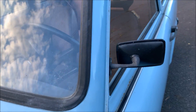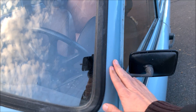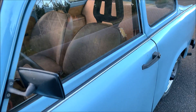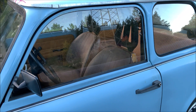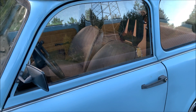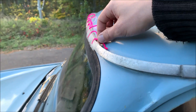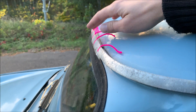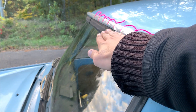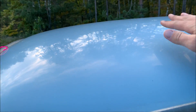The outlet will work over on the outside, where there's quite high air velocity around the A-pillar. Unfortunately, there is a drain at the A-pillar which catches the air and works like a parachute in this area, creating massive separations. These separations are on the side window, causing the side window to shake at certain frequencies — creating noise while driving. Something we work on in great detail today, but at the time it wasn't really a topic. There will be a massive separation from here because all the air hitting this fence creates a massive separation bubble, reattaching somewhere in this area.